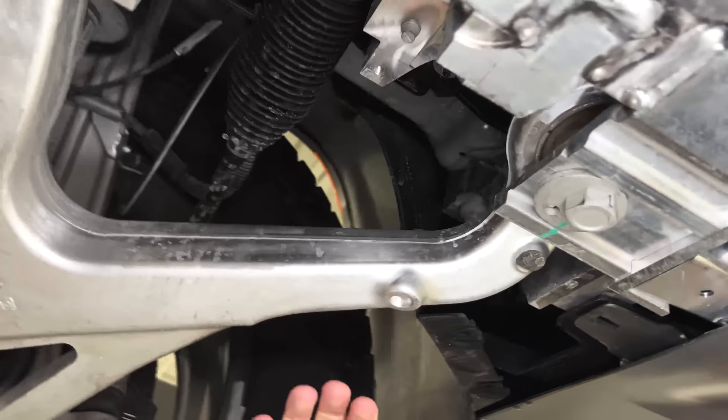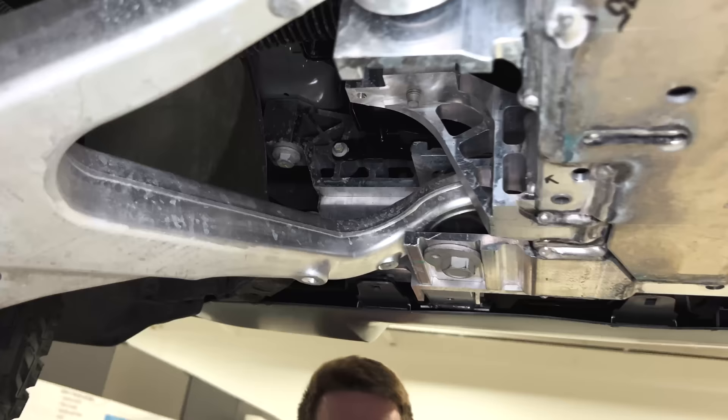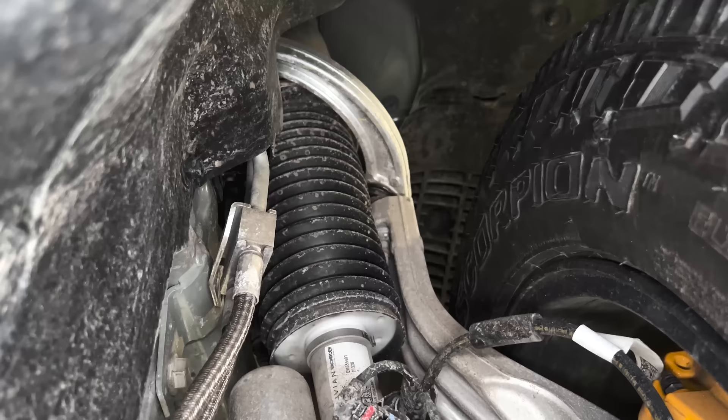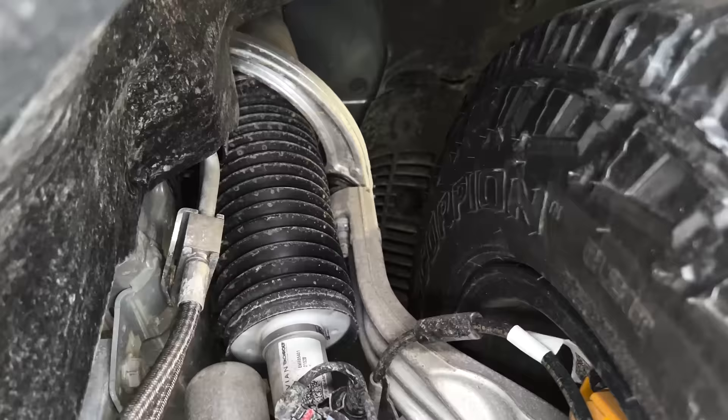It's close — there's a millimeter of air gap on this side but it's on an angle, so my guess is it's tighter in there. It seems tight is the word: it's huge and tight at the same time. In terms of clearances, you can see how close the upper control arm and the top of the knuckle are to interfering with the bellows — that accordion-shaped cover around the air shock or air strut. They're not giving themselves much room for error in terms of the build process, but if you can do it consistently, you can have clearances like this.